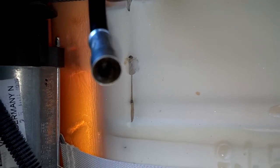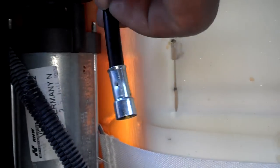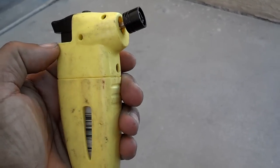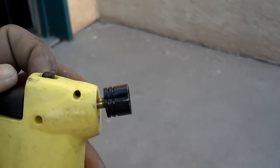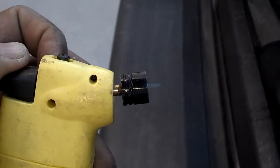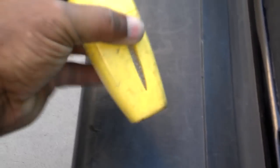Even though I didn't have prior experience with this seat, this one probably wasn't reclining. Next you want to get your lighter or torch and heat this up until it melts off the end of the tip here. This little handheld torch helps you direct the flame well when heating up parts — it has a little safety catch on top, you pull the trigger down the side, and it gives a nice little blue flame. I use this to heat the end of the cable when working on these seat cables on 850s and 960s. You take a standard cigarette lighter, slide it up in there, take the base of the handle and slide it together, and now you've got the torch ready to use.